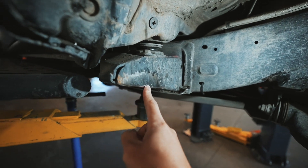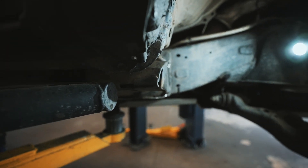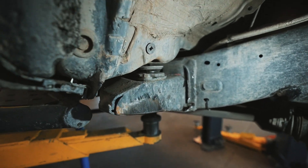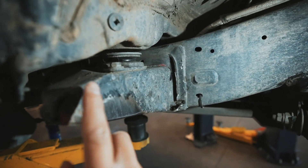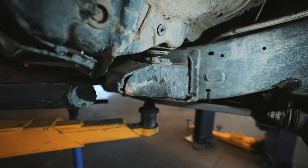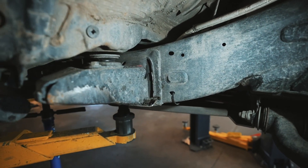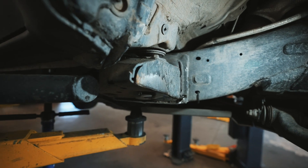As you can see here, Mike was rubbing a lot right here, and that's because this chop wasn't really as far back as it could have been. Since there's not much material left for us to weld on another plate and redo the chop, we're going to be doing the entire body mount relocate. We already kind of have it packed in there, so we're going to finish chopping this off and show you guys the rest.